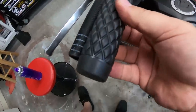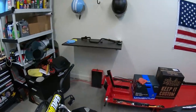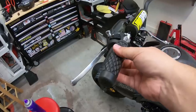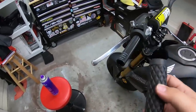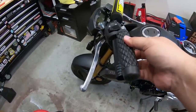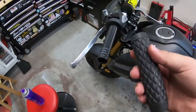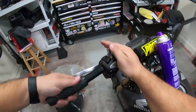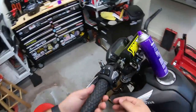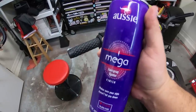I'm going to have to cut the ends off of the grips to fit the bar end mirrors. For grip installation, a lot of places use grip glue, but I'm just going to use hairspray — it's what I've used on grips previously. It acts as a lubricant while you're putting it on, and after it dries it sets, but it's still removable if you need to take them off. Aussie Mega Hairspray — thanks, Australia.